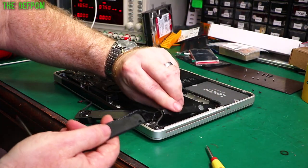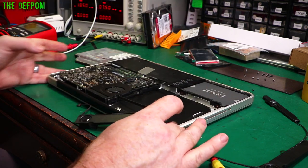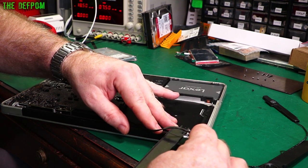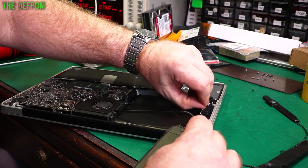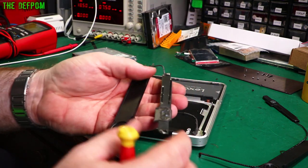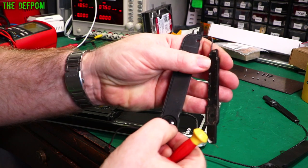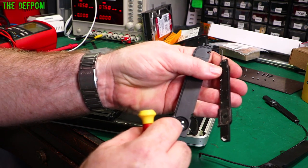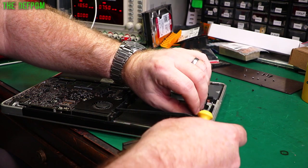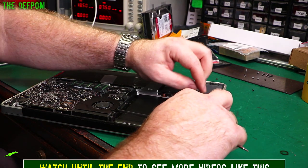It sort of sits under here, stuck in there. There's a tight little gap just in there, coming out of the hood of the keyboard — I've never actually looked at this part before. We've got to get this out. I think it's just stuck down with a bit of double-sided tape basically, so I'll just lift it up and pop it out. There we go, that's it out. Pretty dusty in there. Not sure which one has melted — this one's actually feeling a bit crunchy, so it's probably this one. I'll just get the new one, shove it back in, and reverse the process. Since it relies on double-sided tape, just stick it back in like it was in the same position.